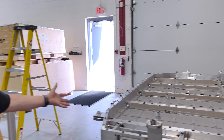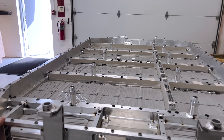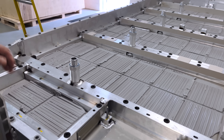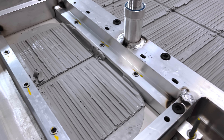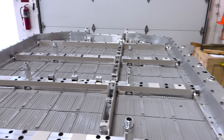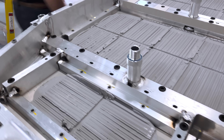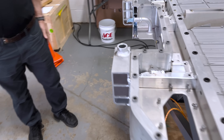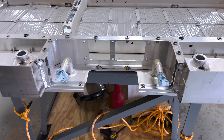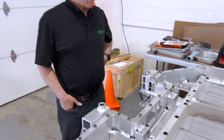We're back to take a look at the EV9 battery tray after all the fun stuff has been removed — battery modules, switchgear, and BMS. What remains is the tray itself as a welded aluminum construction, and you can see the thermal interface material left behind after the modules were removed. The welds are all reasonably good quality for volume production. Their vision of having a single cooler at the bottom of the battery tray is a wonderful idea — the single inlet and outlet significantly simplify the cooling system plumbing and minimize the potential for leaks and maintenance concerns.